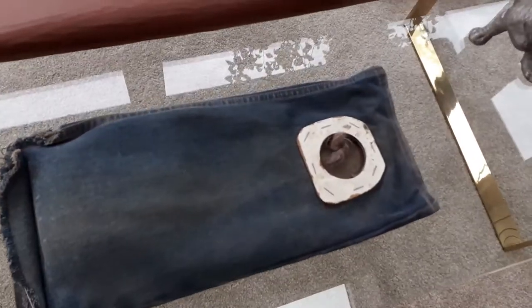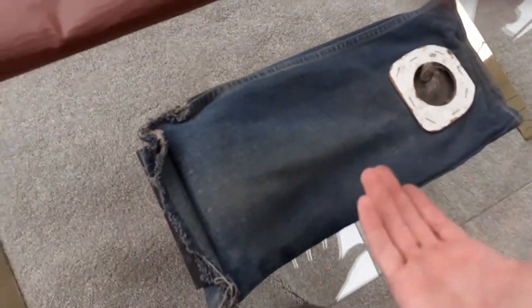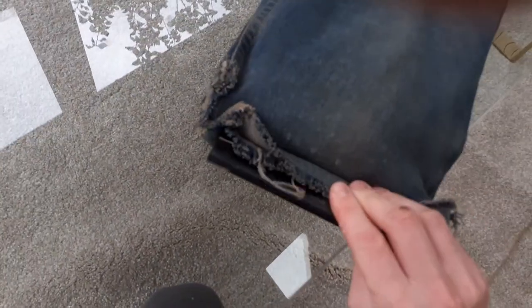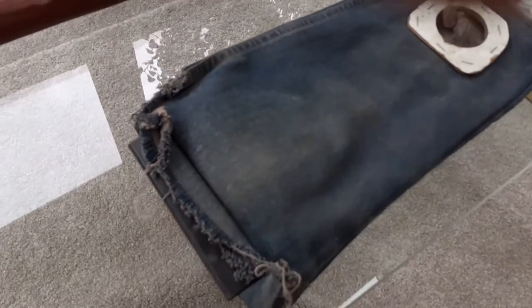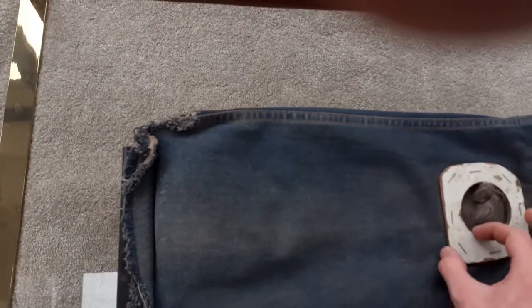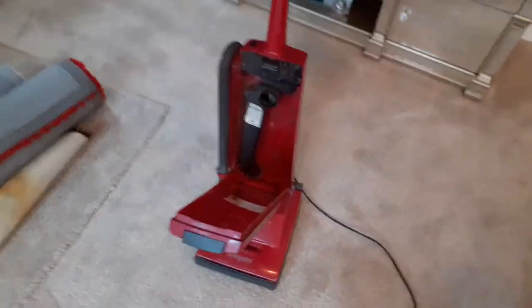It's quite a snug fit as well. I've seen some funny attempts at making bags over the years — I've seen socks wrapped around the fill tube, t-shirts with the neck hole stitched shut wrapped around the fill tubes — but I've never seen such a fashionable way of doing it. I'll keep the slide though, it's an actual bag slide. It was picking up a bit but the suction was absolutely awful. It's going to clog up in no time — the airflow was so bad that the jean was just ballooning open and there was that much pressure building that it kept forcing the bag door open.